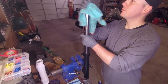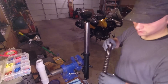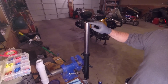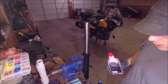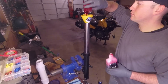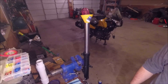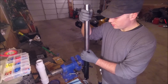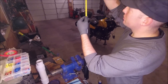So now we can take this back off. The book says 18.5 ounces or 143 millimeters down, so we're going to check both just to make sure. Get the air bubbles out of there. That looks just right.